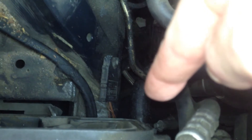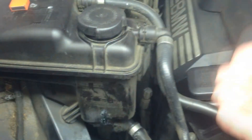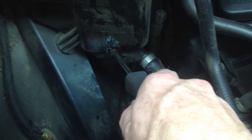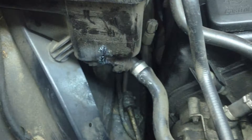So if you're wondering about your coolant leak, first check the sensor down here on the lower hose — that was my problem with the first leak, but now I have a second leak, and it is right here. I'm looking at the dried coolant that is crusted on the side of my fill reservoir here. This is where you pour in the coolant, and this is where the sensor is as well. If you look carefully, there is a little drop that is crusted off right where my screwdriver is. So I know the leak is coming from right there, dripping straight down onto my pan and then my garage floor. The precise location is dripping down below there.